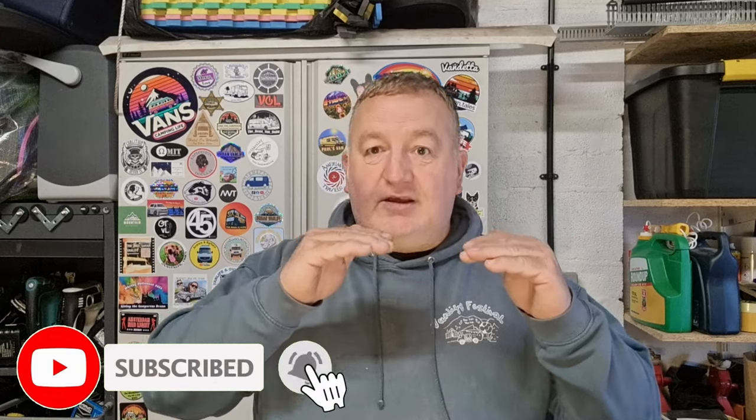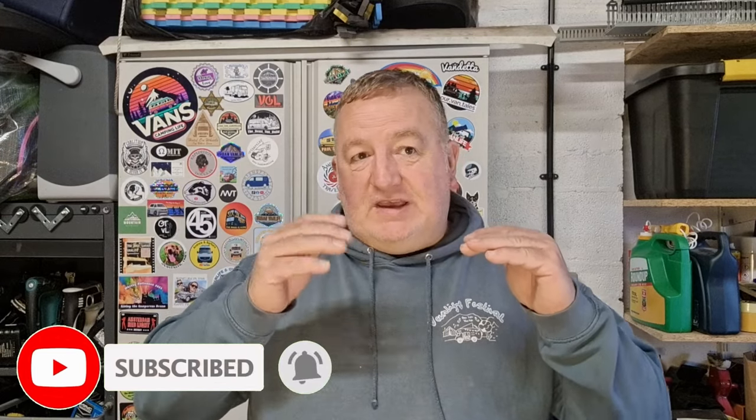Currently there are three types out there. VSRs — voltage sensitive relays — it is what it says on the tin. It basically allows voltage through once your alternator reaches a certain voltage, around about 13.3 volts. It'll allow that to charge, then cut off around about 12.8. That is a voltage sensitive relay. They are proven, they're in lots of vehicles, but I can see them just being phased out in the future.